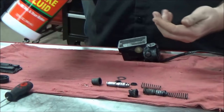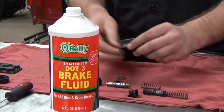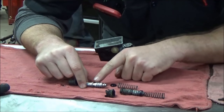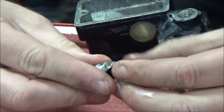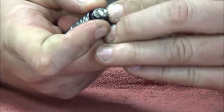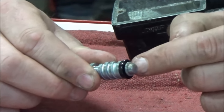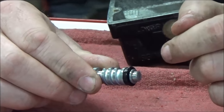When you install these, make sure you are super clean. I'm going to take fresh clean brake fluid and coat these rubber seals. I've got to stretch these around this piston. I don't want to drag it across the threads - I want to cause minimal stress. I've got this thin one well lubed up, I'm going to put some pressure here and walk it around. Once it's on there, make sure you rotate it - if it didn't fully lip on it'll fold over and fail.